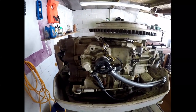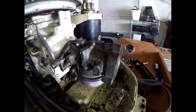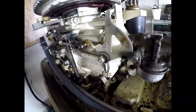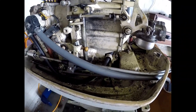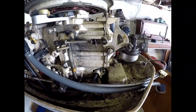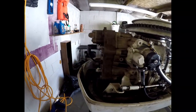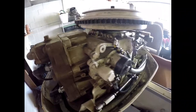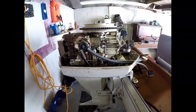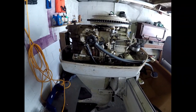The things I'm going to do to this: I'm going to replace the fuel pump, rebuild the carburetor — it definitely needs a good cleaning inside. I had to figure out why the choke is not working. It's got an electronic choke on it, and if I can't figure out what to do I'll just hook up a manual choke to it, no big deal. It's got a new spark plug, I'm going to do new hoses throughout, and I'll probably take the flywheel off and clean the points — it does have points up underneath there. Points are always fun.